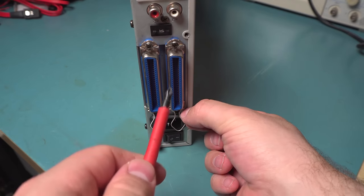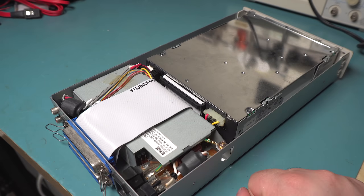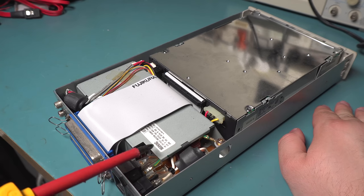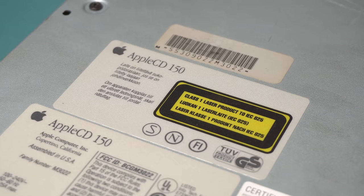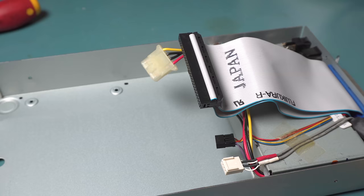These will also boot into Apple's Unix, A/UX. The main layout seems pretty straightforward — just the Sony CD-ROM drive unit, quite heavily shielded. These things are very heavy, by the way. There's also the power supply, which looks like a switch-mode type, and just the wiring with some really old tape on it and a huge SCSI ribbon cable. This is the 150, the third model. The original was just the Apple CD SC, then they made an SC Plus which removed a fan — the original SC had a fan but they found it would suck dust into the unit, so they got rid of it on later models.